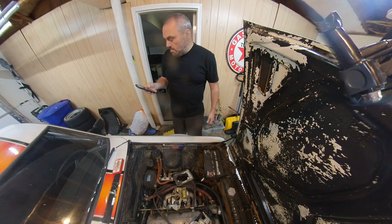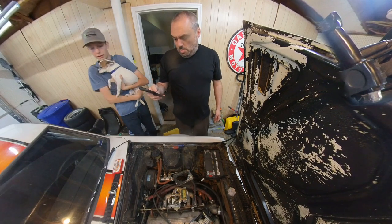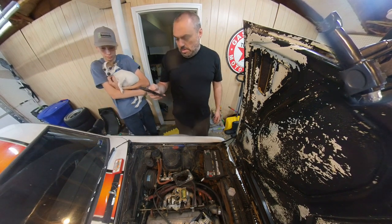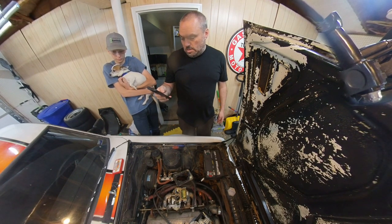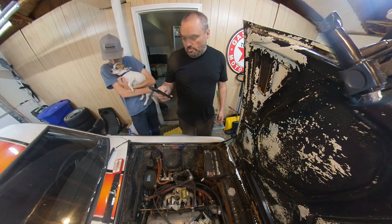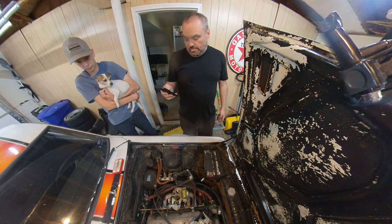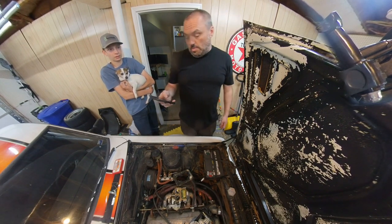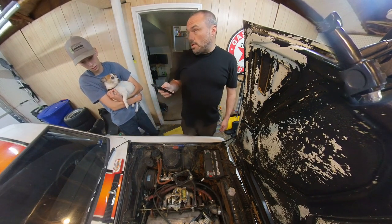Freshman rule. Okay, right now, 145 primary main, 180 primary air corrector, 60 primary idle, 140 secondary main, 200. So this thing says a 140 primary is about right. A secondary should be about a 150 or a 155. I'm going to go 150. And I've got it at a 200. No, I have a 140. I have a 140 secondary main. So I have a lower secondary main. I actually bumped the primary up to 145, which the primary is working good, I feel like.